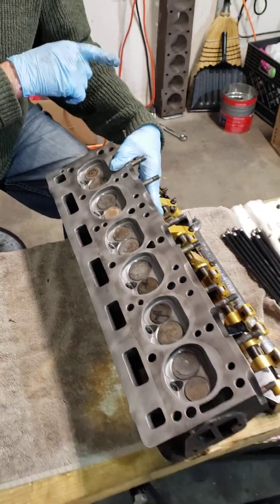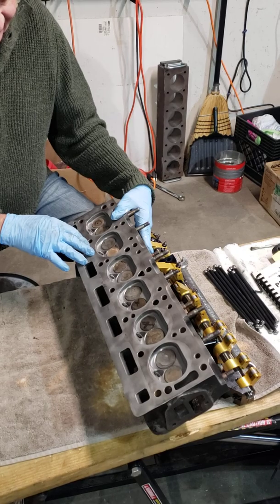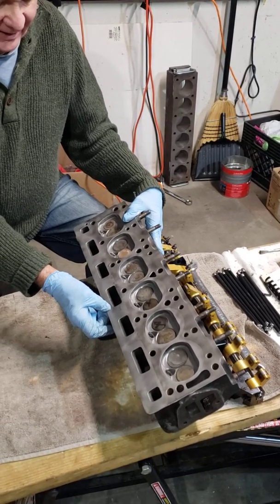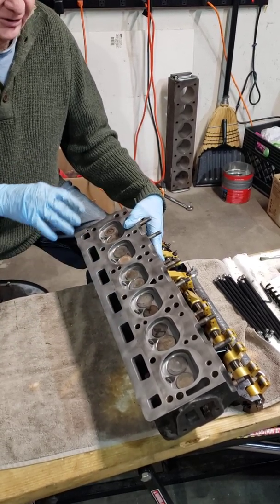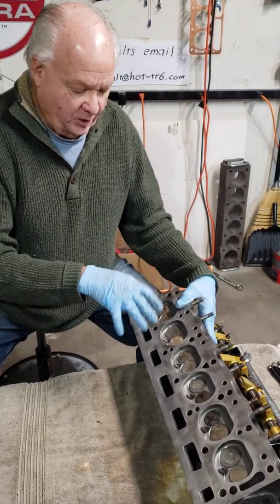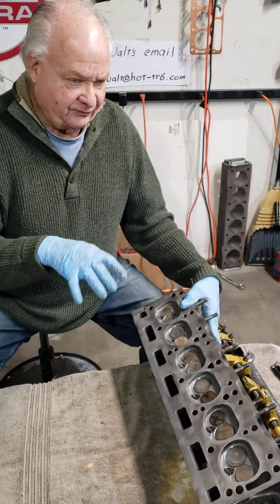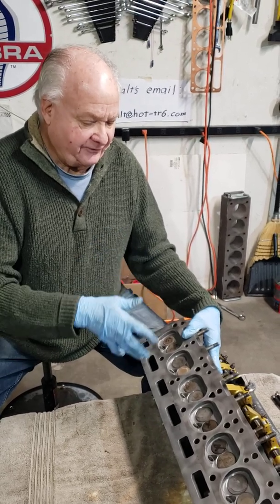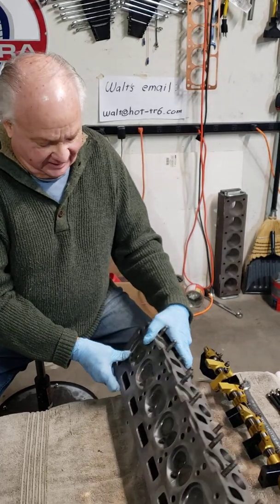Have your machine shop follow the book on that. By taking the quarter of an inch off the cylinder head, there are charts you can go to that'll say what compression ratio you have. For me, I'm working at 12.5 to 1 compression ratio. I drive at 5,000 feet, which is effectively about 11 to 11.5 to 1 compression ratio, but when I get down to sea level, I have to keep that all in mind.